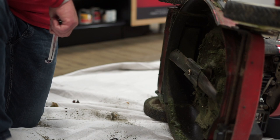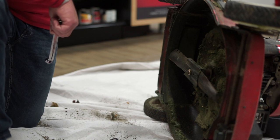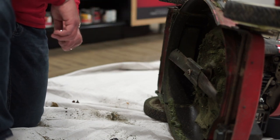To sharpen a lawnmower blade, we need to first remove the blade. Make sure that the fuel tank is empty and that the fill tube on the oil tank is firmly closed, because you need to tip it on its side to expose the nut that we're going to loosen to remove the blade.